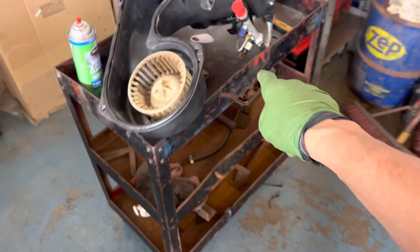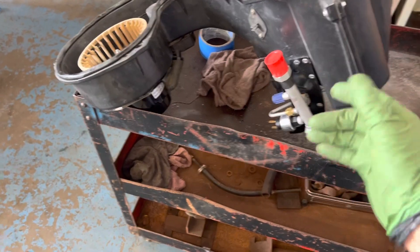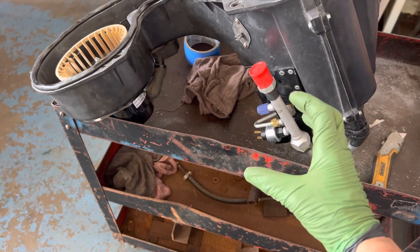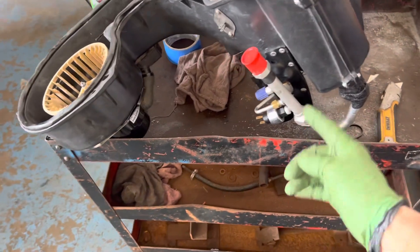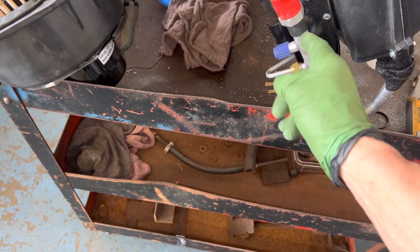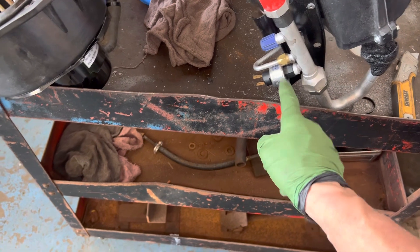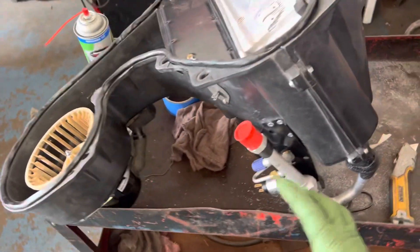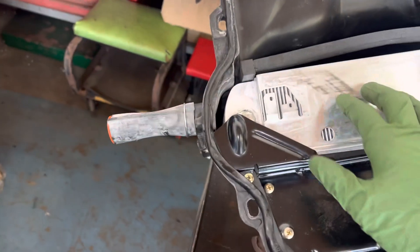They got a modern setup to get rid of the old VIR assembly — it has an expansion valve and a POA device all in one thing. I can't even remember — my dad used to have me rebuild them when I was a kid. But they get rid of that and replace it with this little tube and turn it into a simple cycling system. You got a low pressure cycling switch here, here's your oil return, and they're going to put an accumulator on this, converting it over. Looks like they got a new evaporator.